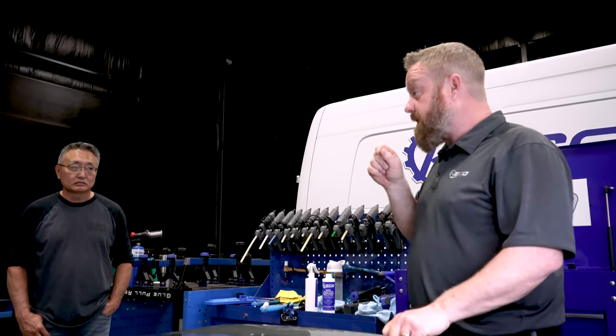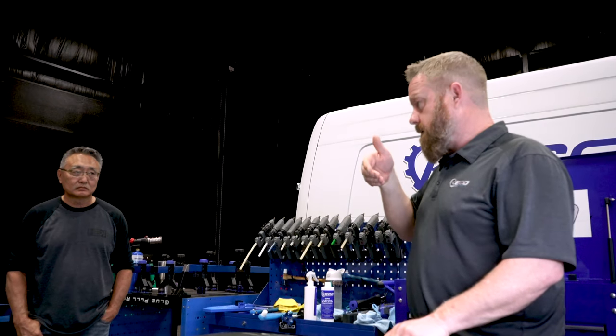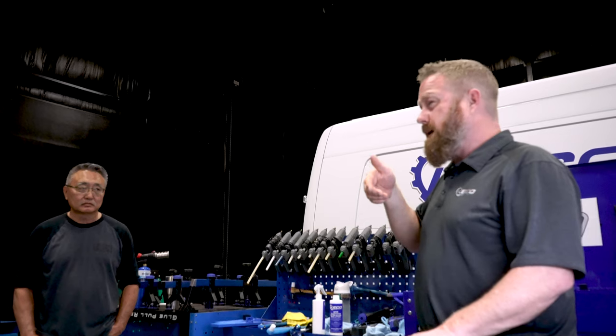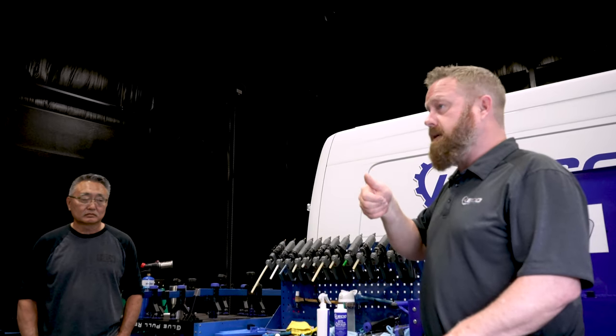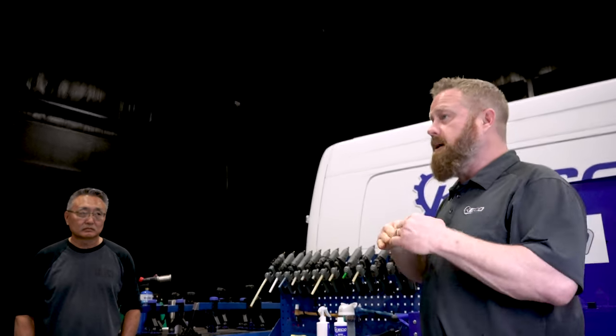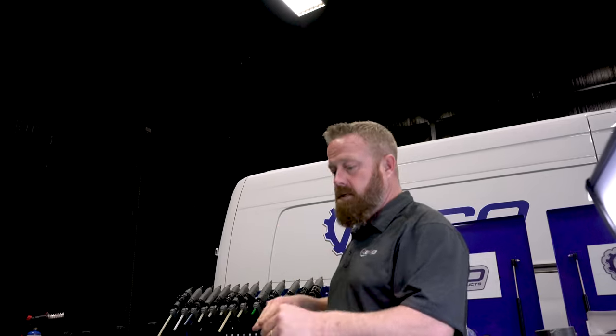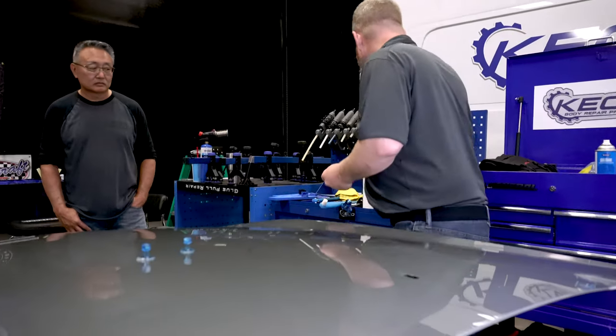There's so much less surface area that I'm going to be a little bit more aggressive with this pull. So I'm going to come in. I'm going to ease it up a little bit, but I will likely pull harder to a bit of a release. What I'm hoping for is to bring that pit up out of this stubborn metal and leave just a tiny high spot that's easy to knock down, is my goal. So let me make sure this tab is clean.